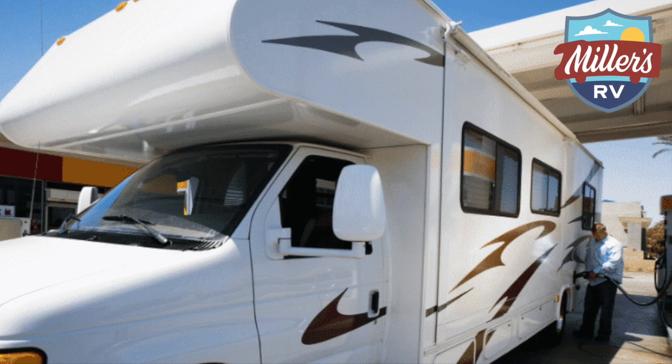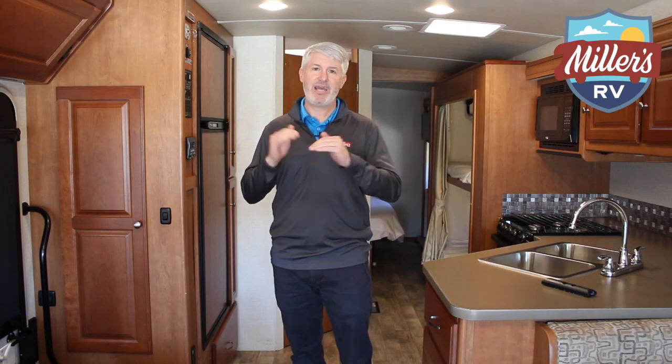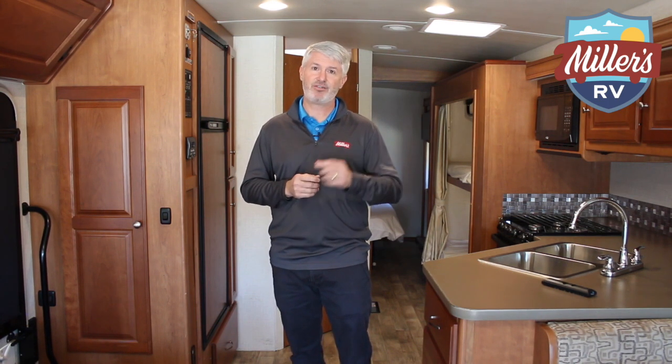If your generator is spinning over and not firing, the most common reason is you don't have enough fuel. Motorhomes have a safety feature where below roughly a quarter of a tank, your generator will shut off — somewhere between an eighth and a quarter tank — to keep you from running completely out of fuel and not being able to drive to get more. So most new RVers try to crank the generator, it spins over great but never starts because they don't have enough fuel. Check your fuel level and add fuel if needed.